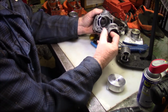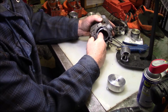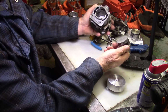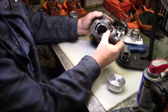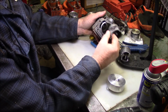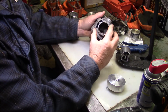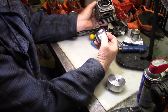It's a possible concept to say that the Meteor cylinder piston arrangement stock can handle those flash heat scenarios, like I was doing with that one saw that stuck, where I'm going on a cold day from idling, where the whole cylinder now is chilled down relative to the piston, right into a hard cut where all that heat builds very locally, really quickly. So there's a bigger difference in temperature from that piston to the outside of that cylinder, and it grows fast. Does the cylinder grow fast enough? Is it possible that these materials that the stock Meteor piston uses grow in sync with its cylinder better than, say, the cheaper materials used by aftermarket companies?